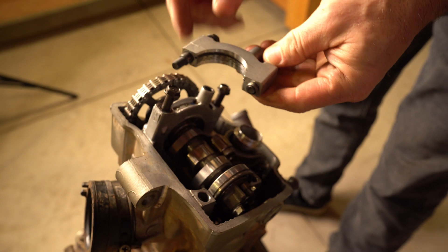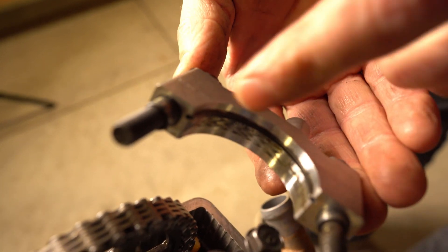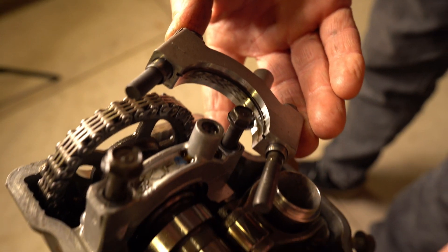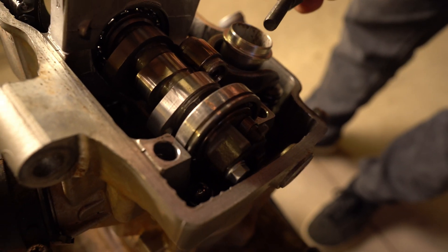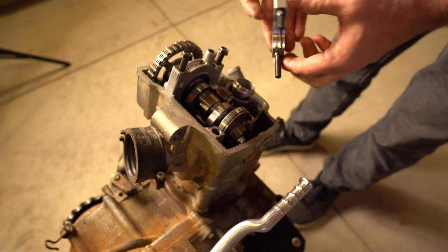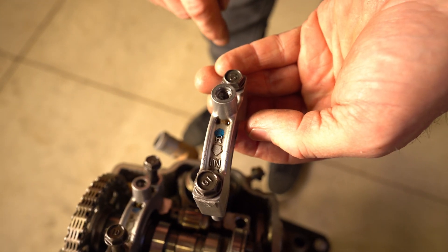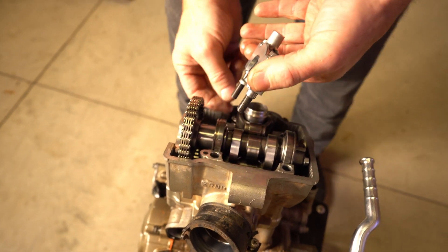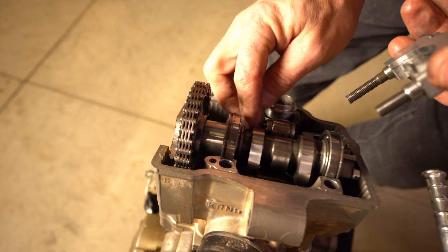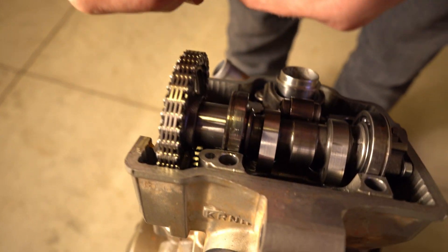You'll see they have this little keeper inside there — I guess it's probably not called a keeper, but it basically keeps it lined up with the bearing. If you look, there's a groove in the bearing and then it has the groove there, and there are these inserts. Make sure you don't lose those inserts — sometimes they'll stay in the head. These are labeled and show which way the arrow goes in. We'll take this other one off — see, that fell. This is that keeper I was saying. I'm just going to put that in there so I won't lose it.